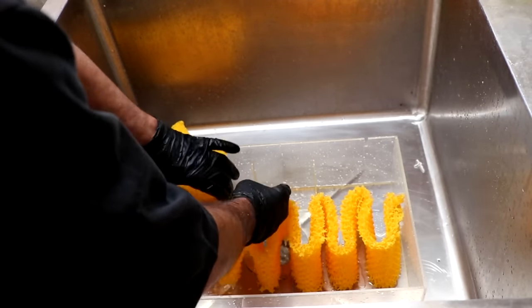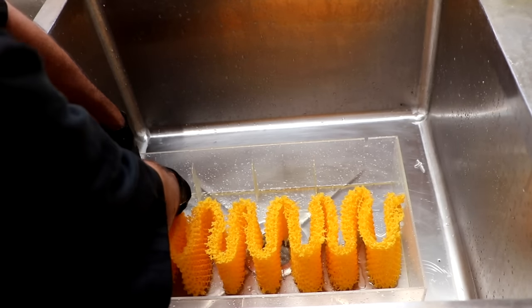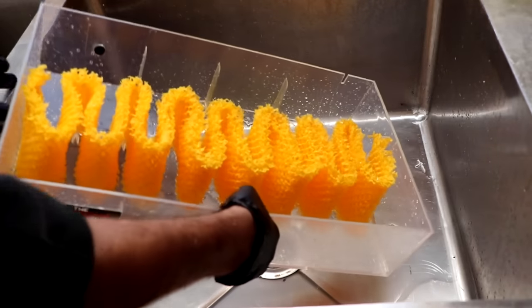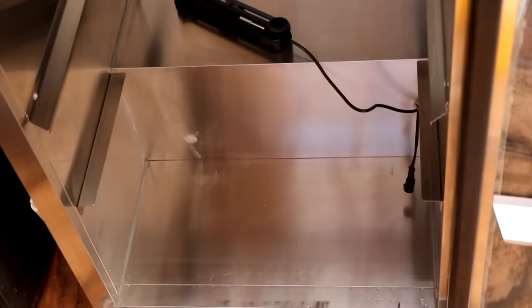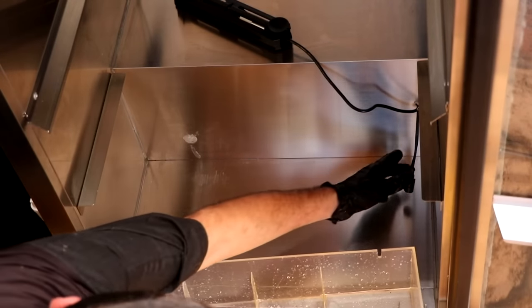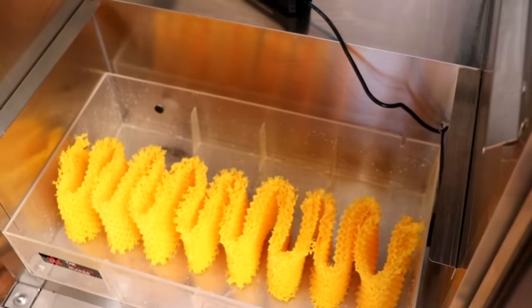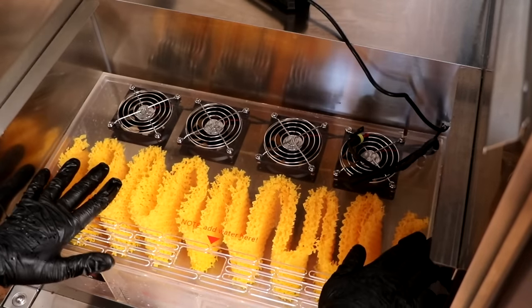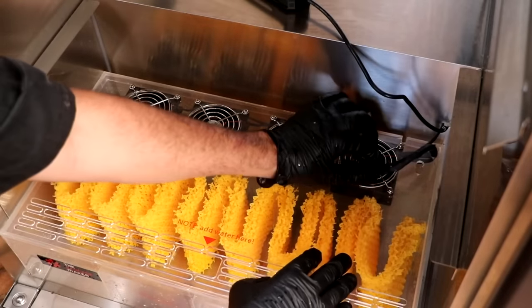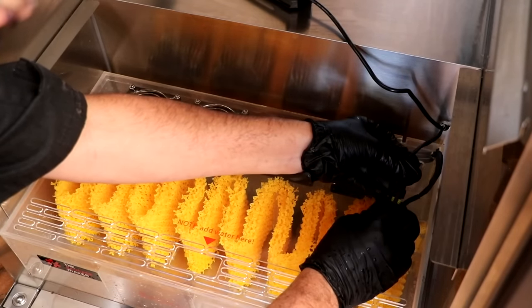Let's get that wicking filter wound back up. You're going to put it in a snake-like pattern, and once you get that completely done, you are good to go. We're going to place this back into the cabinet at the very bottom — it's been rinsed out really well. If you used any harsh chemicals or disinfecting soaps, you definitely want to rinse it out so you don't have any residual left behind. We've got it in the bottom, we're going to put our top on it and reconnect it. This particular top I washed by hand and it's been sanitized. I paid very special attention not to get any of those fans wet.